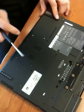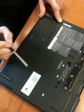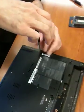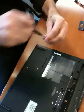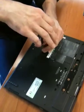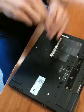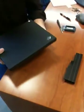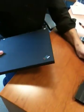All the screws have different icons, but these are the only screws that have the little icon for the memory. So with these four screws, you get a Phillips head about that size. Loosen a couple of them, and what I usually do is flip it over and hold my hand over them and then they'll come out.